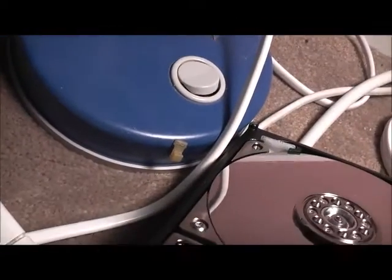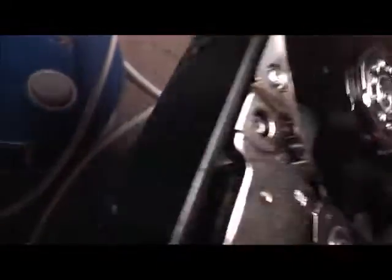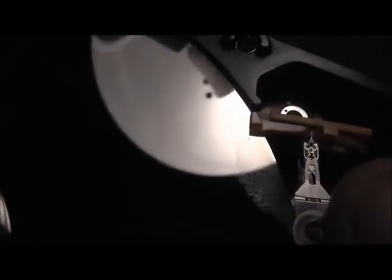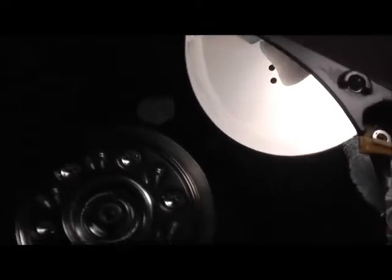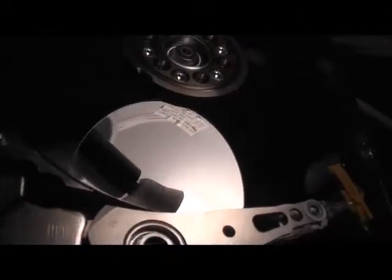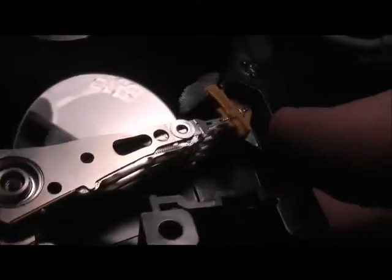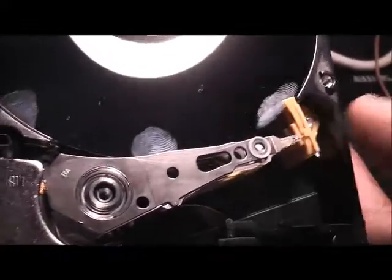There's severe damage in this drive. I pulled the heads off — the one on the plate has got big gouges on it. I pulled this out and unplugged it. Quite a neat design. They're actually quite well-made drives, though the firmware on these green drives is the weakest part — it parks the heads every eight seconds. At the very end of the head stack are the sliders, and they can break. They're guided in a plastic ramp. These are in pretty good condition, and the ramp is in very good condition. This had 707,000 park and un-park cycles on it, with 650-something days of operation. For nearly a million parks, I don't see any real physical wear. Very good design — this little parking concept. It has a fluid-bearing motor, no ball bearing — very reliable. Very thick platters, and it's got two filters.